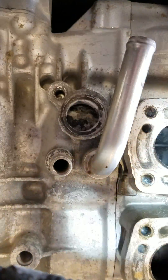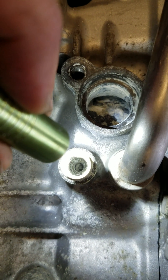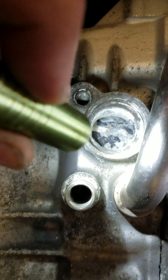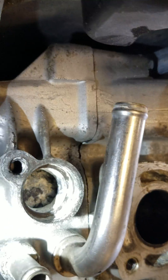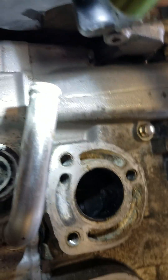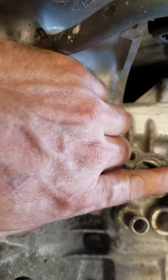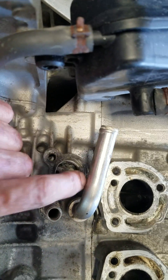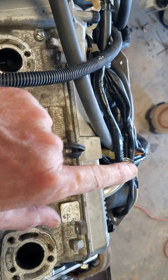Trying to get the light right on top of it. Down inside of here — there you go — is a hole. So that was completely clogged. This hole here goes upwards to the cylinder head, up underneath, like right in there. This is where the water is flowing up into the cylinder head, goes through the head, and comes out of that pipe right there.